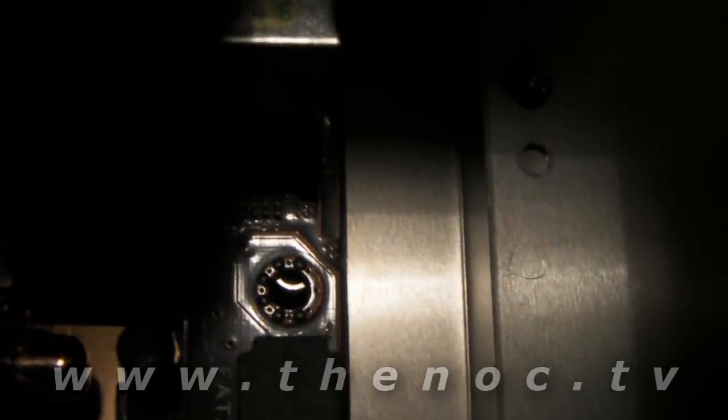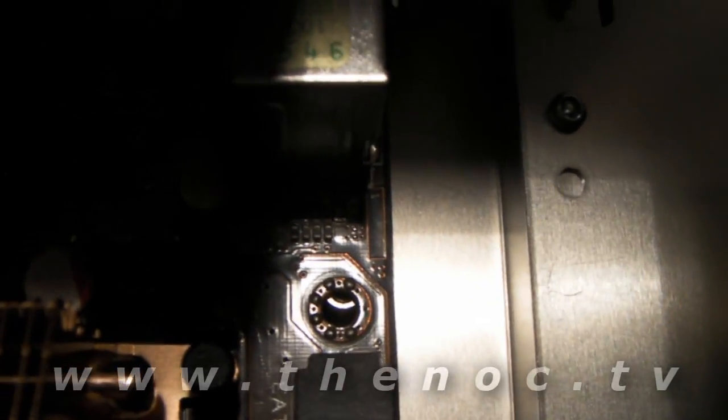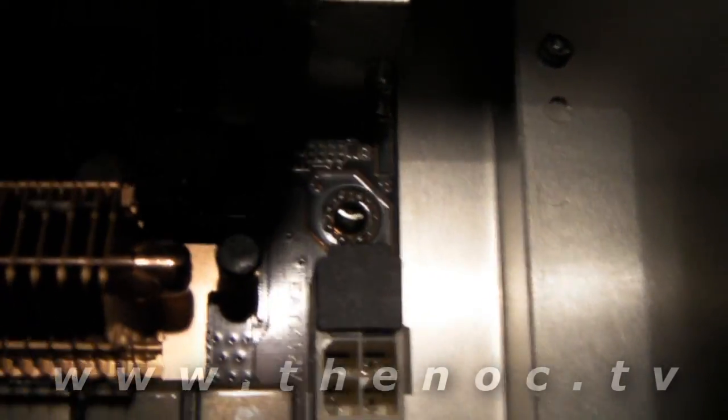As you can see, we got the I/O shield plate in, and now is the tricky part where I will need two hands. You'll see that if I go through and look at the standoff holes, they're not matching up with the hole in the standoff and the hole in the board. The reason for this is the shield plate has padding or is providing physical barriers, so you're not able to simply just slide it all the way up so it lines up nice and pretty.